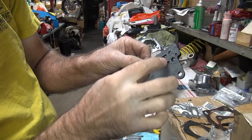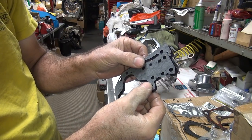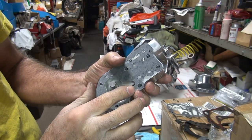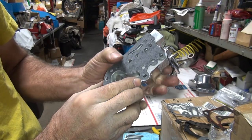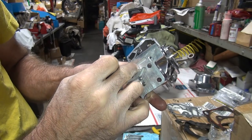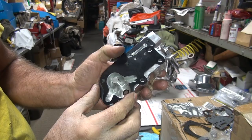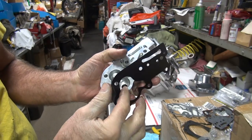We've got the blow-off hole up in here, and then we have the crossover right there which separates the two cavities. So how many of those do we really need? Pull out your pump, put your gasket on there. Those don't do anything — we're not using them. Blank. Don't need those. We need all the mounting holes: the four holes right here, this hole right here, and the slot. The slot goes completely across, so we don't need that in there either. You don't need that gasket. You can use this gasket right here — everything lines up. You've got the same holes. It all lines up the same. You don't need their stupid gasket.